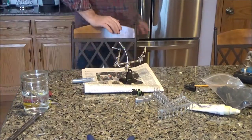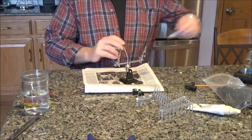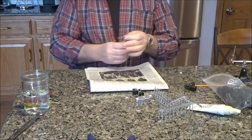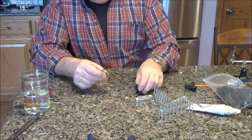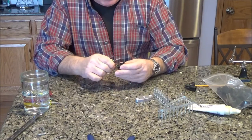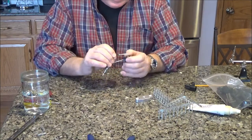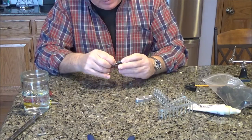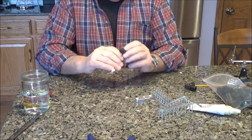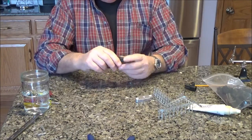Let me unplug the iron. At this point those are ready to be gently inserted into the connector. It doesn't matter which one goes where, so just give it a push. You heard a nice click there. We'll get this one in - all happy. Got a good click there. The pins are all the way in, and then we simply close the back of the connector.